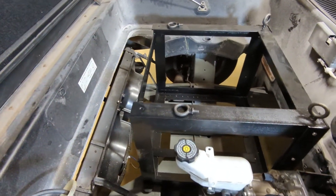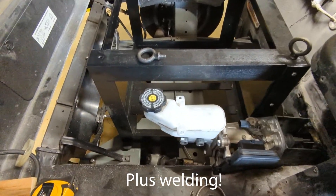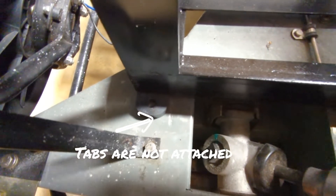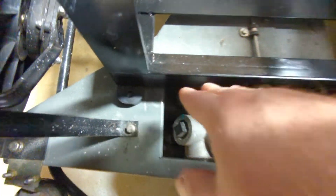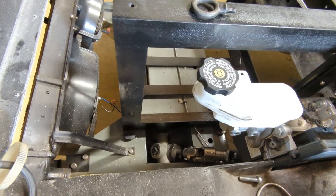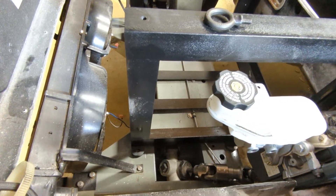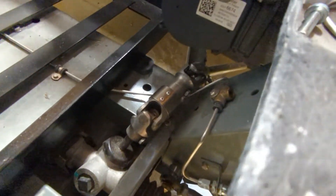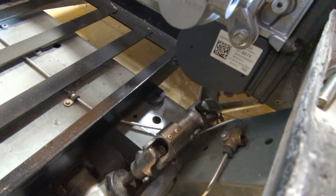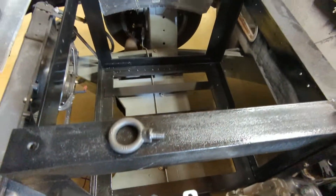There are going to be four mounting locations, so the entire job I'm doing is basically putting four bolts in — but I have to drill through the frame to mount those. Here's the first one right here. You can see over to the right, this is our steering rack. This whole plate area is called the front frame extension. It's bolted into place and relatively strong, but I wouldn't want to mount the entire battery pack just to that front frame extension. So I mounted it as far forward as I could there. And looking under here, there's the other mount position in the middle on this side, sitting right on top of that cross member. We're going to put a hole on the left and a hole on the right, and that is mirrored on the other side.